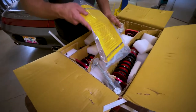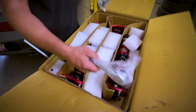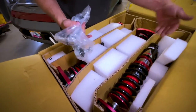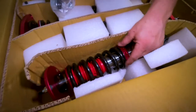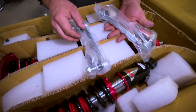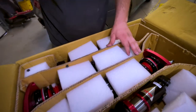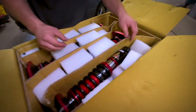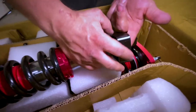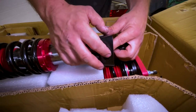This is actually the second set I've installed on his cars. The first set was actually the one that Fred painted. These are nice — they have the right adjustments for spring pressure or preload and height adjustment. They come with new tie rod ends because the old ones are a different length when you adjust it. On these, I'm going to show you later, but you can easily get to the front and the back of this hole. These are the rears and this goes to the rear sway bar end link.